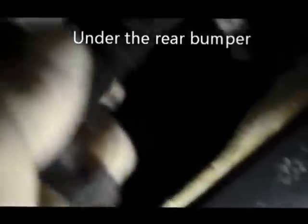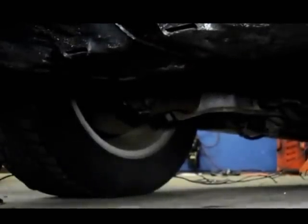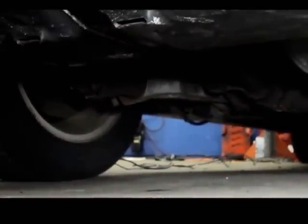The plug is right underneath the back of the fuel tank. There's a little pin — you just push that pin in and pull it apart. We unplug it and check pin number six, which is right in here on the harness. With the key in the on position, pin number six does have power. So we know power is coming to the pump, but the pump is not running.